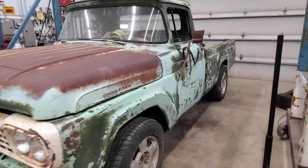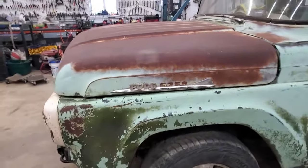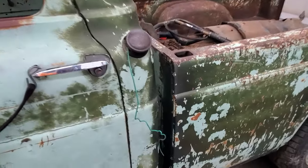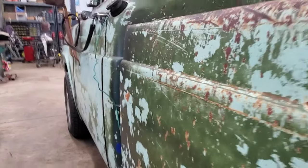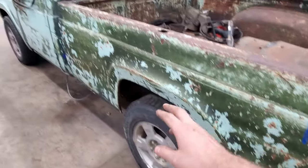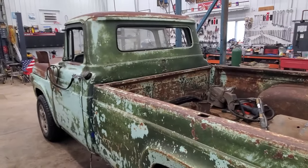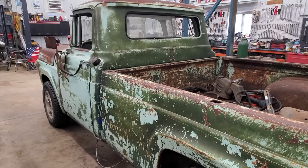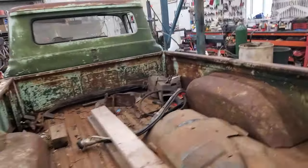Just like that we got the hood on — looks not too bad. Still have to have some final adjusting of all the gaps here, but overall not too bad for this old farm truck. It's a little low — the box is about a quarter inch lower than the other side, so I'm going to have to shim the box up. There's going to be a lot of shimming here and there to get it dead accurate, but we're looking plus or minus a quarter inch in this thing.